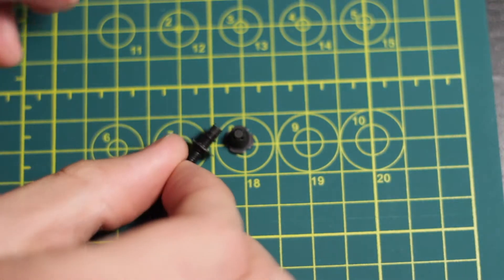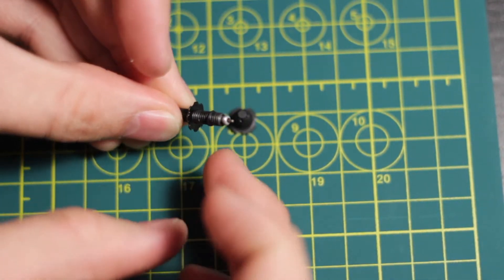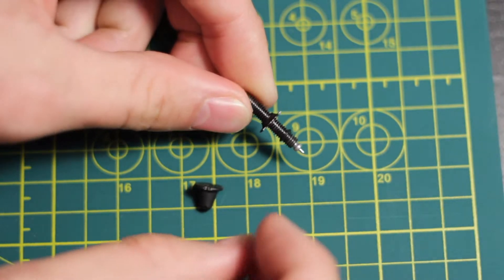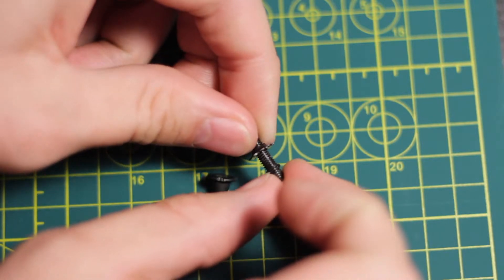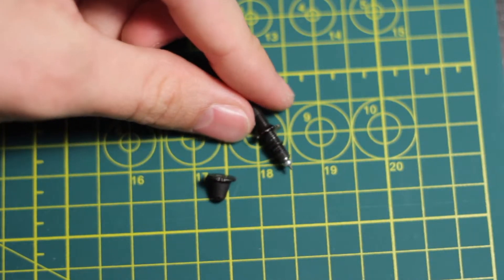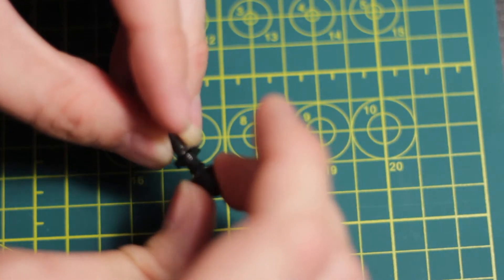As we put it back together, step one is obviously putting in a new battery. I'd get the lock plate farther down the tube, just well out of your way. For the O-ring, I'd start by getting that out of the way too — the easiest way to manipulate it is to stick one of your fingernails in the threads and turn the entire tube. You'll find that the O-ring moves along with your fingernail and you can get it around pretty easily. Once the lock plate and O-ring are out of the way, we can put on the top post with the LED module in it.